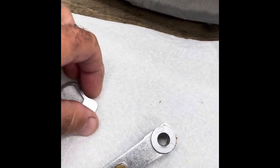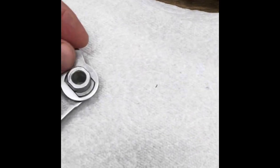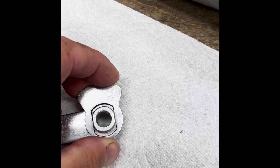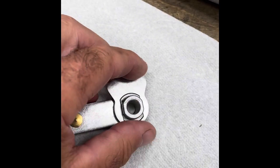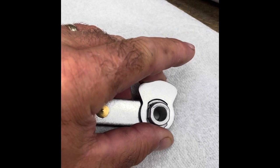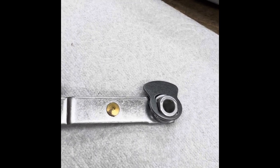The problem is there's slop between this and this arm. I'll just show you here what I'm talking about. This piece, which actually fits on here, has ever so slightly wiggle — see that? So this is having friction on it, but when you push forward on the throttle, the spring's pulling it back and it just moves that much, which is enough to cause about a 200 RPM fallback, which is really annoying when you're using the boat.